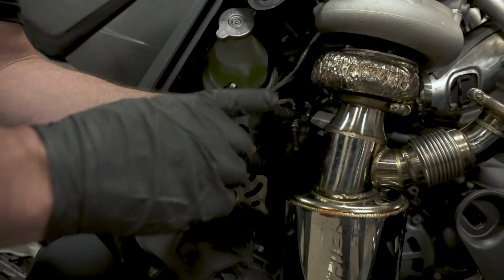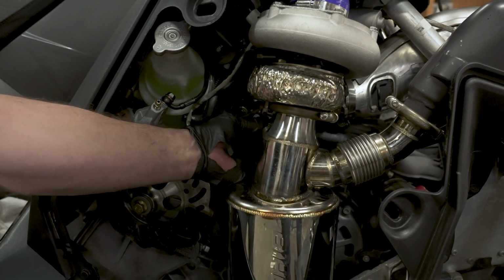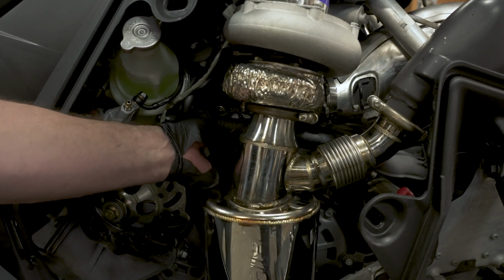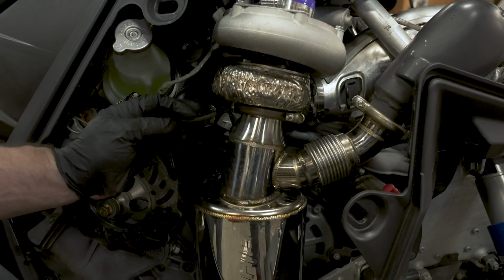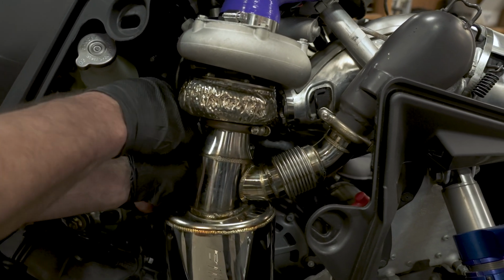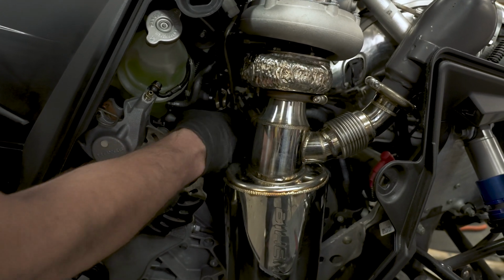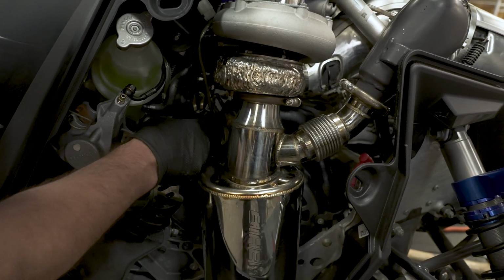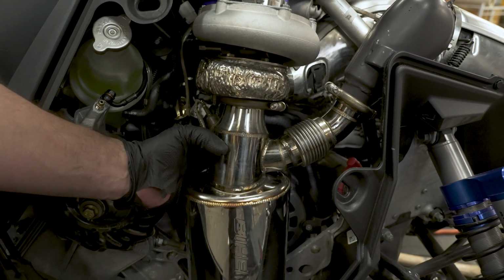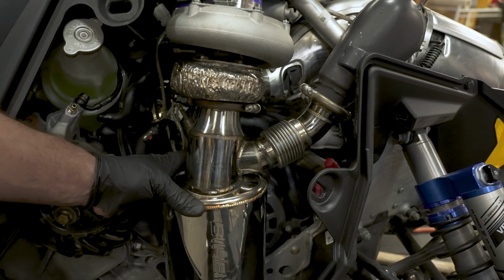And also, after you get everything lined up, get your exhaust sensor back into position, and go ahead and tighten that up. Again, just get her snug. You don't have to kill it. Again, that's a 17 millimeter. Then be sure to keep the center lead away from the recoil rope here. So you want to zip tie that off just so it doesn't get rubbed through by the rope. And go ahead and also put on the muffler spring. Goes from the frame up to the muffler body here.